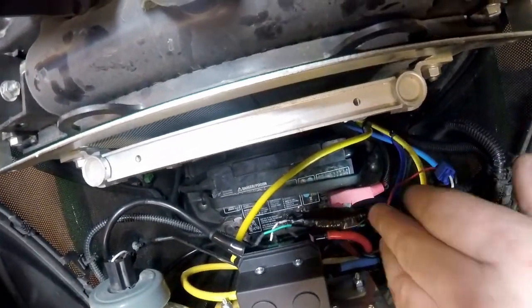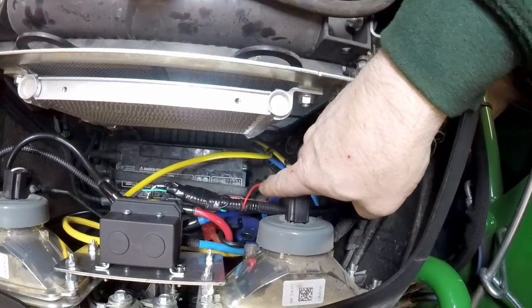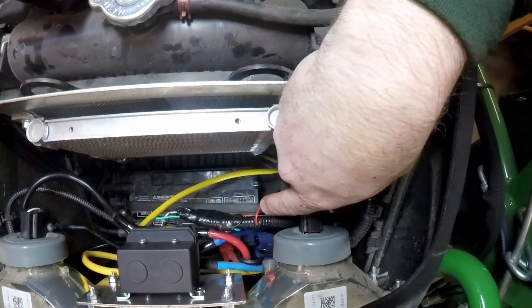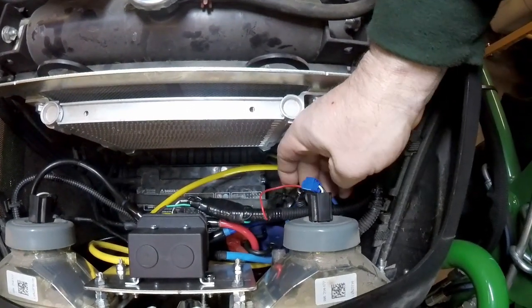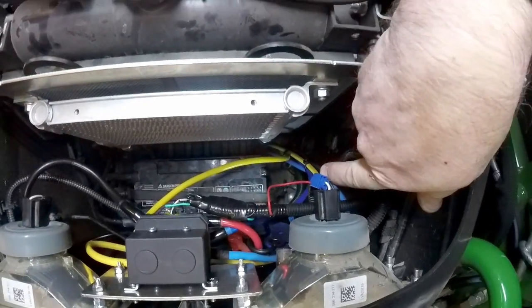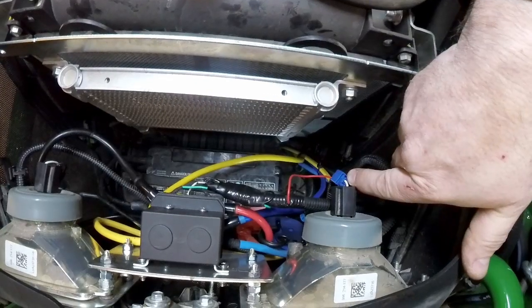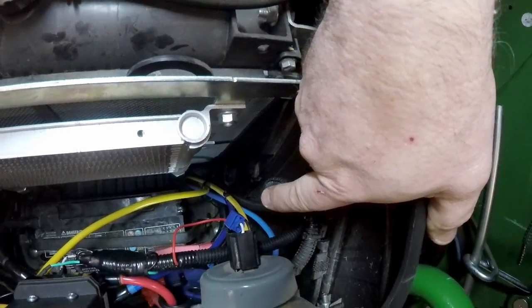Here's your control cable — this red wire turns on and off your relay to transfer power from your battery cable. Now they suggest you hook this into a keyed ignition switch. My only real option here was my headlights, and this was my idea to hook on to this. I suggest you hook it on to wherever you feel comfortable. This way the winch only works when I turn on my headlights, so these control power cables do not carry any current unless my headlights are on and I activate the winch.